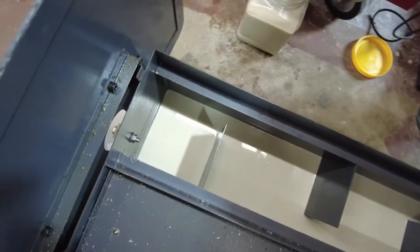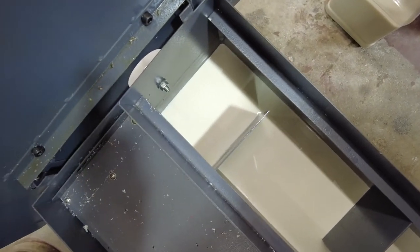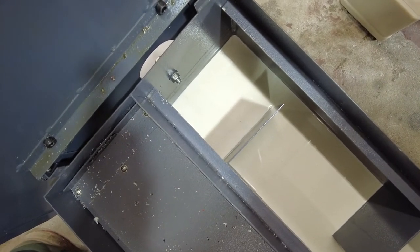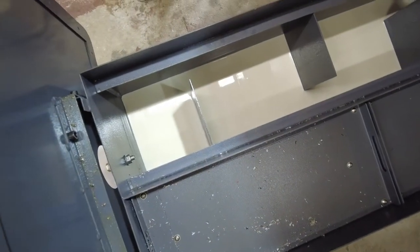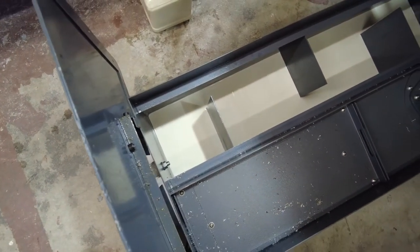The bottom bolt of my sight glass is still below the level of the fluid — that's going to be a problem. I obviously can't pull that off there; my pan isn't going to hold all the coolant that would be let out. So I've got to scoop more of this coolant out. And at the end of the day, I'm going to have to get it all out because I'm replacing all my coolant right now anyway.